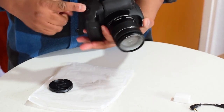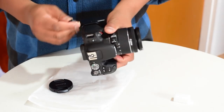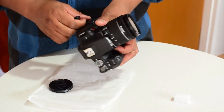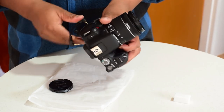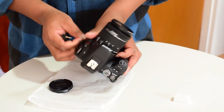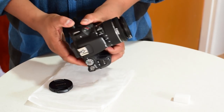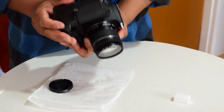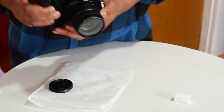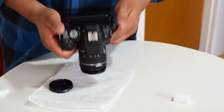If you are interested in using the shutter button from your new battery grip, get your shutter cable — the 3.5mm shutter cable — slide it in, open your socket compartment, and slide it into your remote control access. You should be able to use your shutter cable just like any other battery grip.